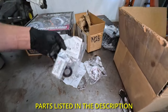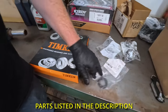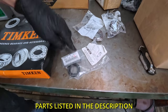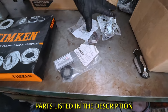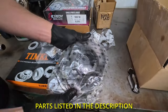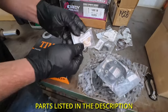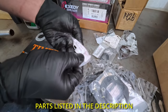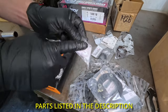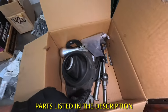And then we have seals. One is on its way — the transmission output shaft seal. These are all the seals I'm doing: Timken rear main seal, and the input shaft seal. I'm going to show you how to change that out. A lot of times people think the rear main is leaking, but it's actually the input shaft seal. New axle seals, because why not? We're here. This is a shift boot kit with the lower boot, the upper boot, and the reverse lockout for the six-speed only — the five-speeds don't have that. And then this is a NC1 six-speed gear lever because the transmissions have different size bushings, so you want to make sure you get the correct one for whatever transmission you're putting in.